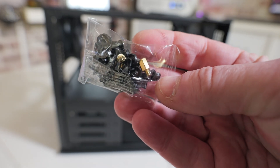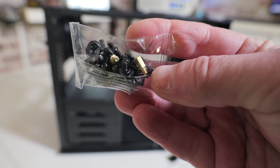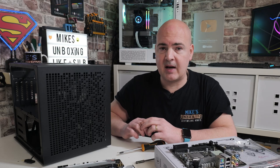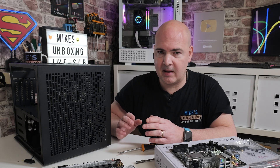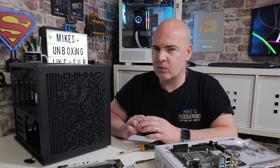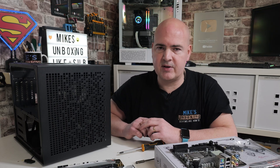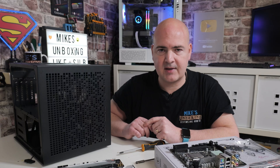But what do you do if there's a pillar in the wrong place and you can't physically move it? Really, you should be able to move it, but if there's some sort of bad design going on, what you can do is get some electrical tape or just a bit of card or maybe a little bit of rubber — something to try and isolate that metal from the back of the motherboard. It shouldn't cause too many problems. But if you're not entirely sure, please feel free to reach out to us in the comment section below or head over to our Discord.